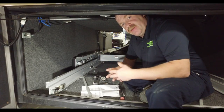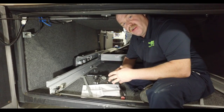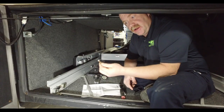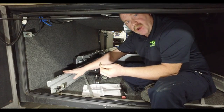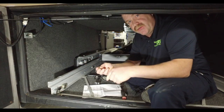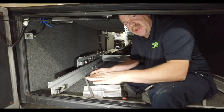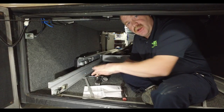Most recently we're coming into problems with these, mainly due to the age of the bay slide. This particular one is caused by improper screws mounting the actual frame rail into the coach. This should actually be replaced with a carriage bolt going all the way through with a nut on the bottom. That keeps the frame rails nice and secure to the bottom of the coach and it doesn't cause any binding going in and out.